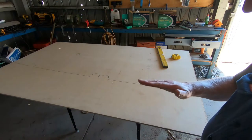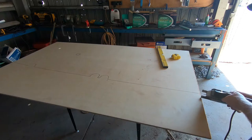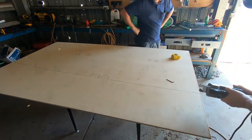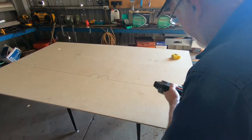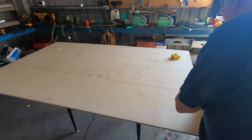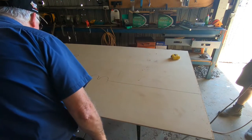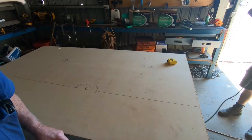We've got to cut in on an angle, so I've got to set it up that way. So we're just going to have to reset the jigsaw. Basically, we're just cutting it on a 45 that way. That's how the old floor was cut out, so we'll just do the same on this one. Push the timber across. Now we've got to make sure we don't hit the table. I'll just move this camera back.